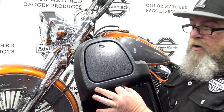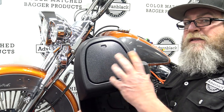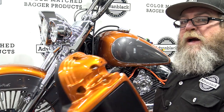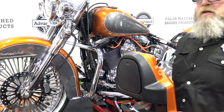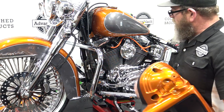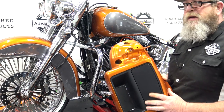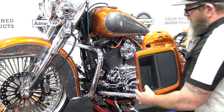You're going to have a slider down here — it has a little plastic bar inside. You're just going to unclip that and take it off. Put the new speaker pod on, clip the new one on, flip it back over, put your three screws back in, and now you have a pod with still a workable vent slide at the bottom. Now, there's a very specific way that these go on the motorcycle. The vent goes closest to the engine. So just remember that the vent goes closest to the engine.